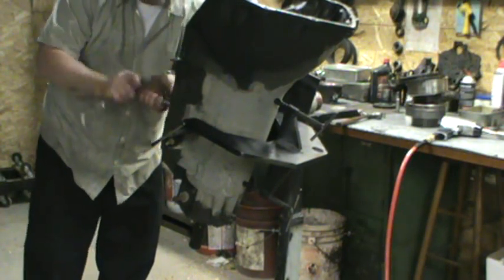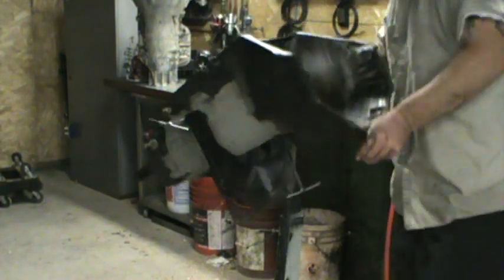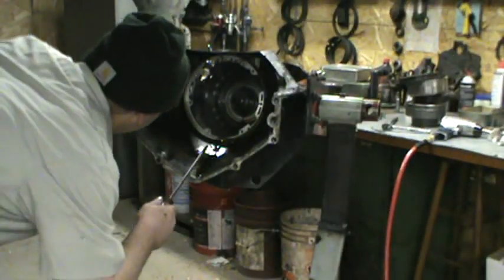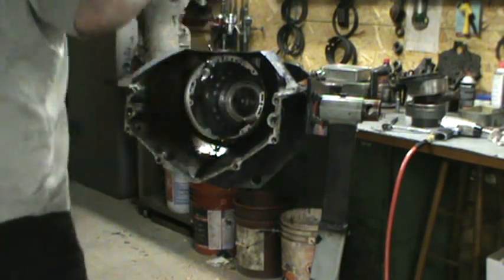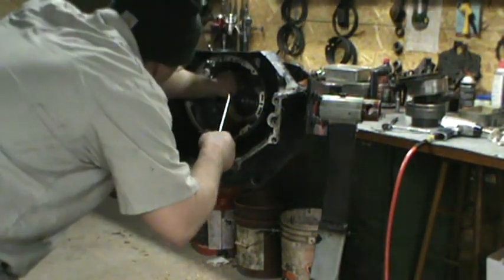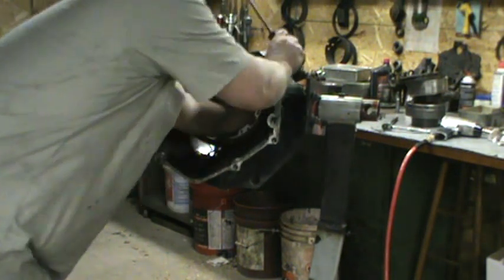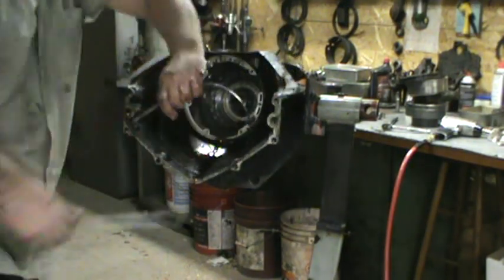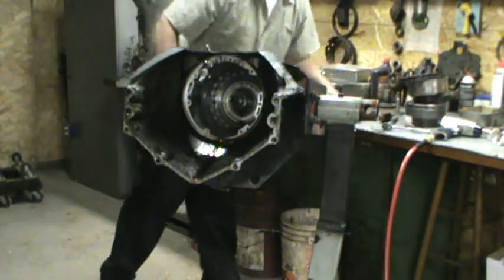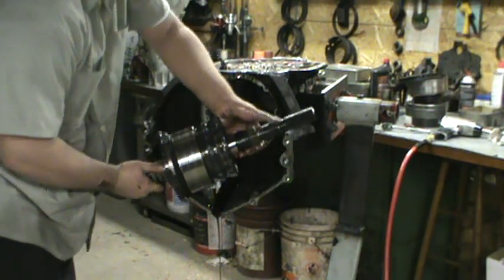I've got four minutes left. Put that in our dish. That's a mess. We've got to do our retaining ring. Take our bevel retaining ring. This is the bevel side up for the center support — it goes in the same way, don't forget that. It's easy to get the clips for the intermediate and the center support mixed up. And the guts come out. We've got our center support, front and rear planetaries.